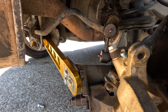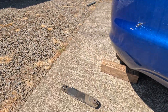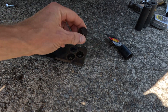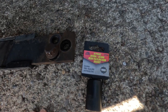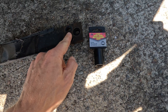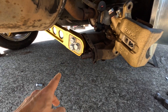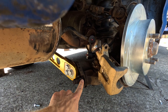If you have factory rear trailing arms, the three bolts here go in and this is your center bolt. The bolts that hold it in require a special 10-point socket — it's only designed for this application and requires a special 19-millimeter Honda/Acura rear trailing arm socket. I paid 10 bucks for it; it's a lifesaver. You do not want to strip these or you'll have other issues. Mine's aftermarket so I'm going to loosen these as a precaution to allow movement as we adjust this nut.